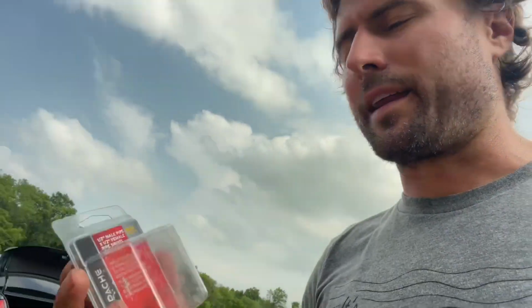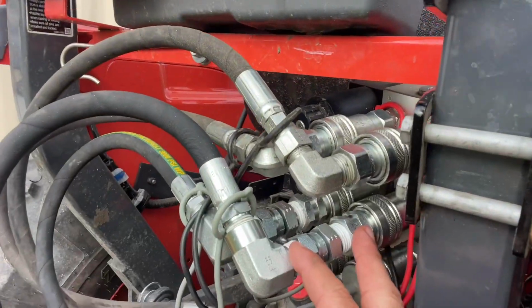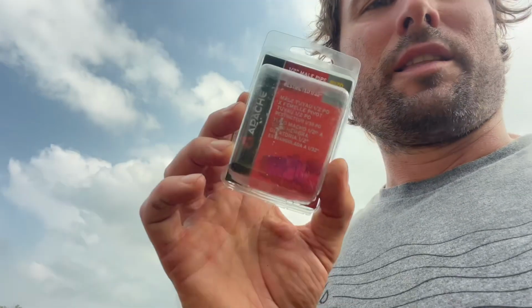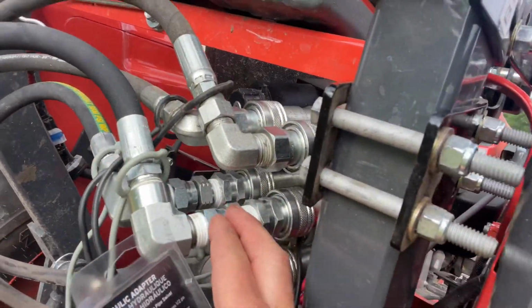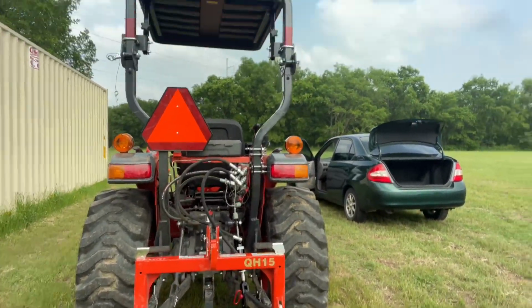All right, last update on this video for this install. I went ahead and added these flow restrictors right here on my connections. So I got a flow restrictor there and there for the tilt valve, so that it used to be just violently fast. That made a world of difference. I'll show you what that looks like, but these are super simple installs. Just separate it right there, add it in, and then reconnect everything. Everything looks really nice and tidy now. I'll show you how that works.